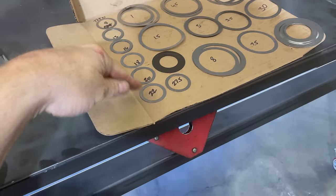We're checking the preload on the bearings with a beam-style torque wrench so we can watch as it goes around and get an idea of what the preload is — you want some drag on the bearing in the pinion, dependent on how tight you make it. Once we've got the pinion in and the bearing preload set, we put the carrier in and take a look at what our backlash looks like. The spec is between six and ten thousandths — we're right at six. Those holes on the front of the housing are for the case spreader, which pulls the case apart just a couple of thousandths to give us room to drop the carrier assembly in.